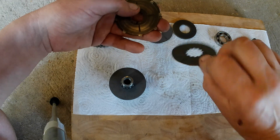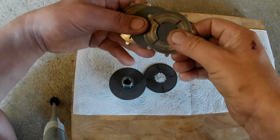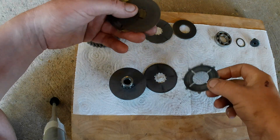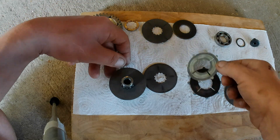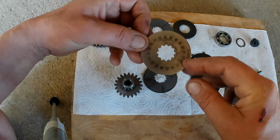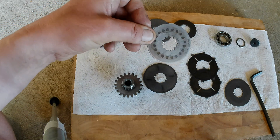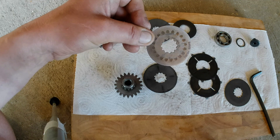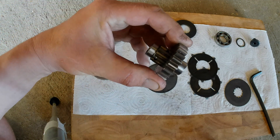Next is a shim, then a double-sided friction disc, then the disc with ears on it, another double-sided disc, another disc with ears, and finally a very thick single-sided disc which you can't fit in the wrong position — you can see where the teeth from the other gear have chattered on it and left an impression.